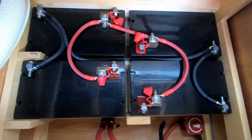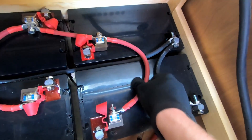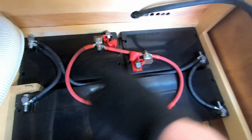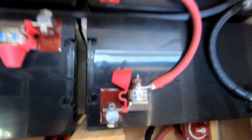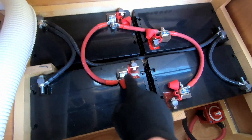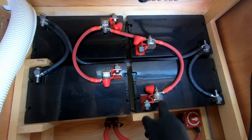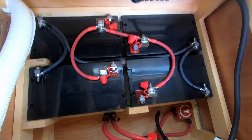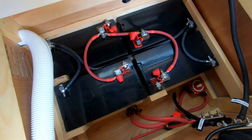That short circuit event inspired me to wait for these terminal fuses to come in before I did any more battery wiring. I have big 2 AWG cabling in between all the batteries and they're all wired in parallel, but in between each positive terminal there is a 200 amp terminal fuse that would essentially blow if a wire happened to touch the fused terminal as it did before when I accidentally dropped it. I highly recommend these — they're kind of pricey, 20 to 30 bucks a piece — but they could prevent a massive electrical fire inside your van, so I'd say that is highly worth it.